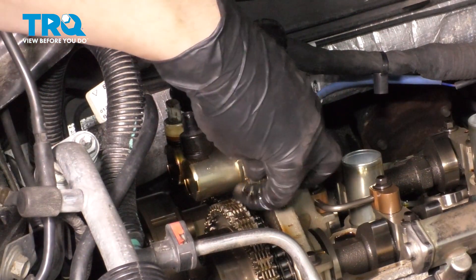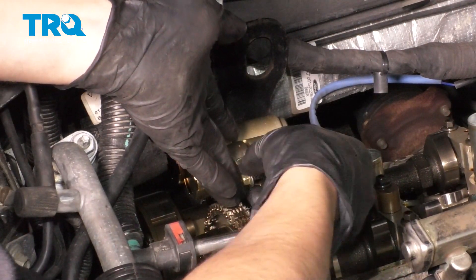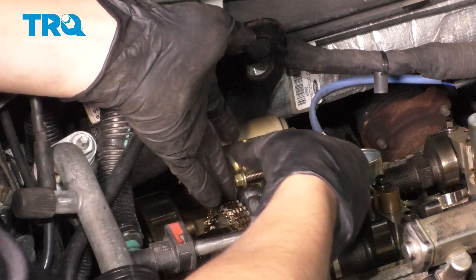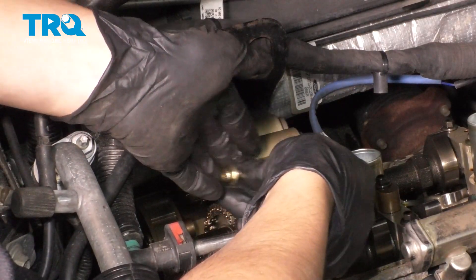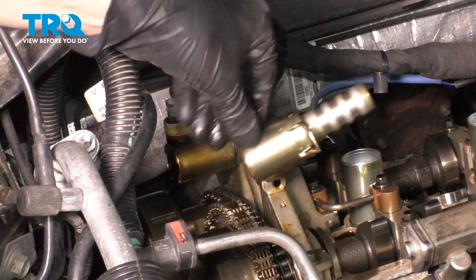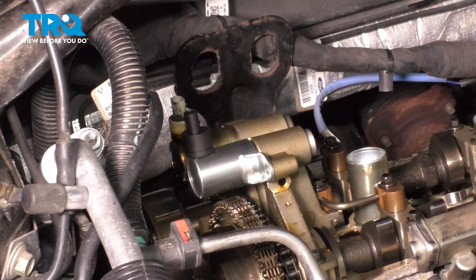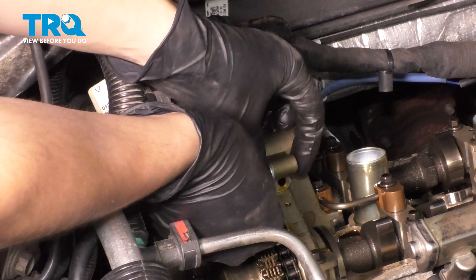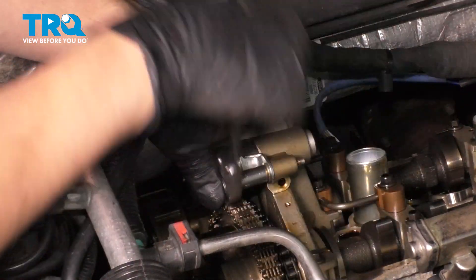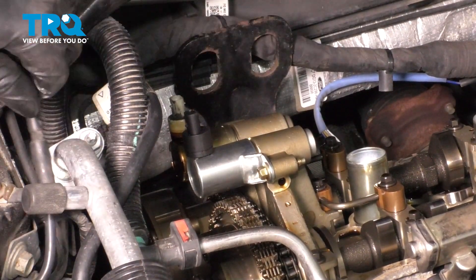As you can see, the solenoid pops out. As you take this bolt out, make sure you don't drop it into your timing chain area — if you need to, get a magnet ready to catch it when it comes out. There it is — be careful, pull it out, take the solenoid out. It should slide off very easily. Grab the new solenoid, slide it in, line it up, and let's put the bolt back in — be very careful once again. Once you get it close, bottom it out. Once it's bottomed out, just give it about an eighth of a turn — nice and snug — that should be plenty tight, and there you have it.